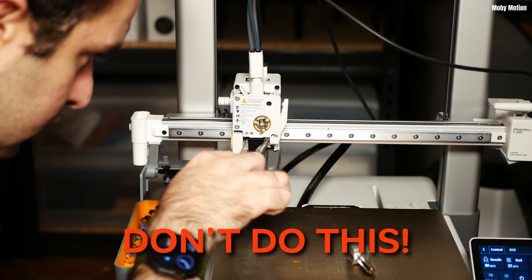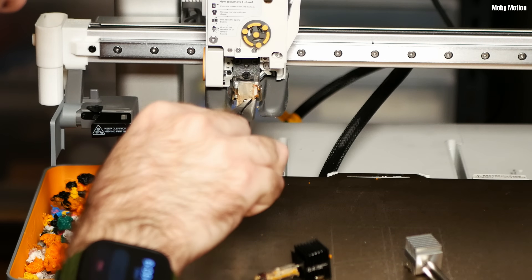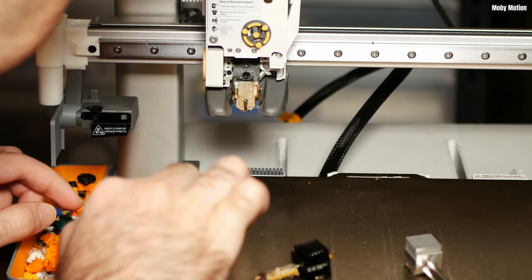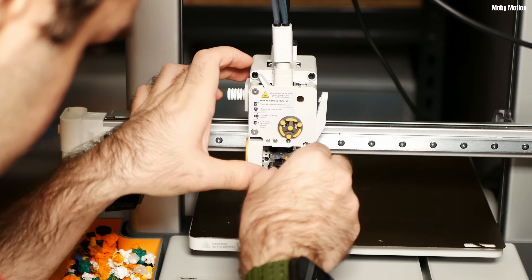This confirmed there were subtle bits of plastic blocking it, because when hot the plastic moves out of the way and the nozzle fits. So I went through more cycles of heating and cooling — with the nozzle in place and clasps on, I cooled the nozzle and waited for a safe temperature, then used pliers to remove the nozzle. It does scratch the heat sink a little, but it allowed me to keep doing these cycles, taking off small bits of plastic each time. I had to repeat this at least once or twice more.